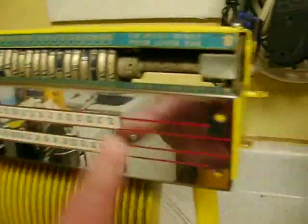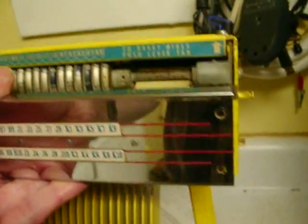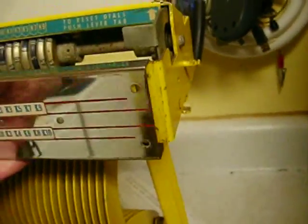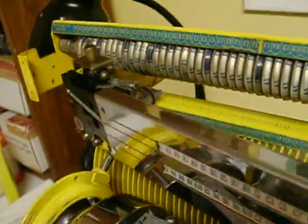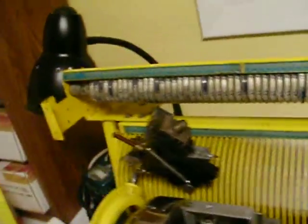Then there are four screws that hold in the selection 'Now Playing' chrome bar. You take the four screws out. Then you remove it — there are kind of hooks on here — and you slide it off of the popularity meter assembly and the lamp assembly for the selection 'Now Playing.' Then you just slide it off like that. All right, and that gets that out of the way.